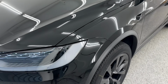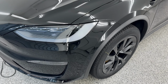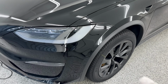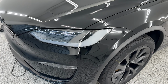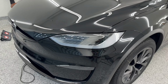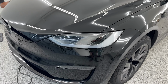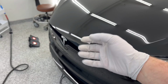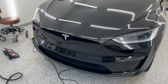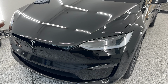It is absolutely insane. Now, one thing you guys may notice here is I don't tape off the plastic trim during the polishing stage. Polish typically doesn't harm these areas quite as much as something like a more intensive compound does, where it'll turn it bright white. And the other reason is if you're getting tape into your pad during polishing, it's gonna hurt your finish, and then it's just an absolute nightmare to deal with. So during polishing stages, I don't tape anything up.